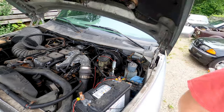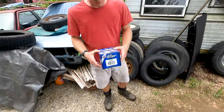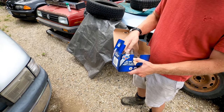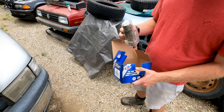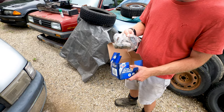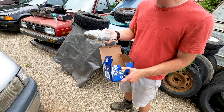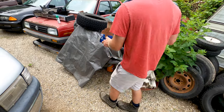But I have the pump I took off of the blue truck way back when I thought it was dead, but it was actually just the fuel was frozen. So I think what we're gonna try and do is put this pump on this truck and see if it'll pump some fuel. We'll just leave the electric system hooked up so we can run the truck, and then probably hook up some kind of a fuel can to the mechanical pump and just see if it pumps anything.